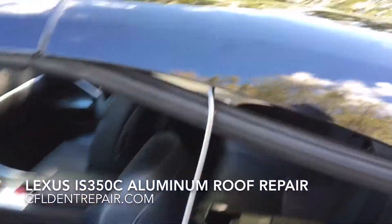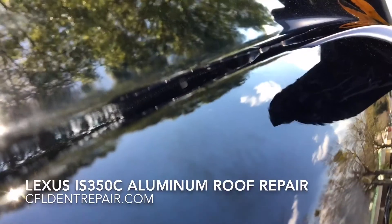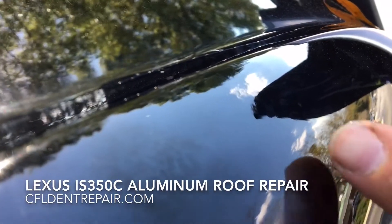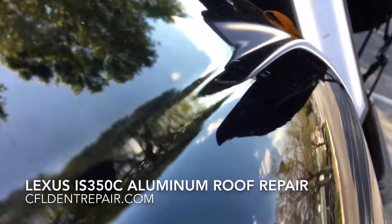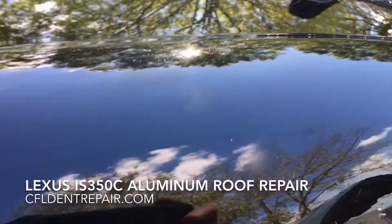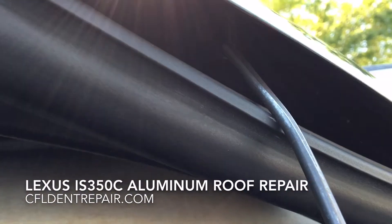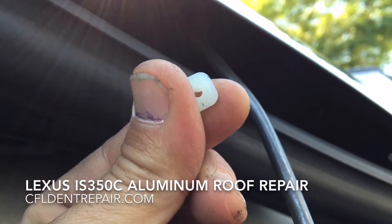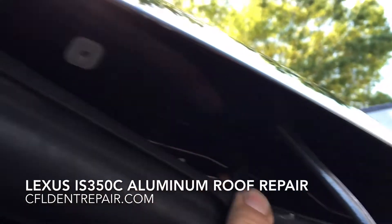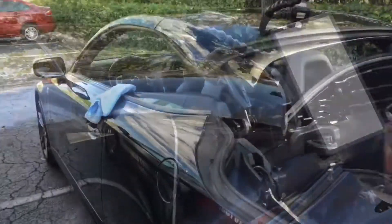You can see here I've got the tool inserted — it's a small hand tool we're using to kind of push this aluminum back to its original shape. Now we have to keep in mind that aluminum does not take deforming as well as steel, so there's a lot more time needed to make this repair perfect. But we definitely have the right tool on it, and you can see this is the little plastic nut that came out of there in order to get that tool behind the dent.